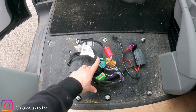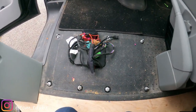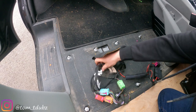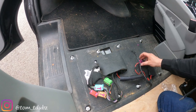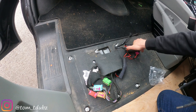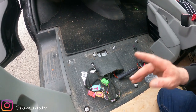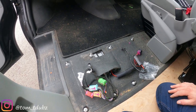Once those brackets are removed, what you're left with is a bit of spaghetti. What we're going to do is shove that underneath the mat — but what I'd suggest you actually do is feel underneath and thread this down to around about that position, and thread this one down to around about that position too. You don't want to forget where you've put stuff, so ideally remember that you've put your cigarette fuse down there. If the cigarette fuse goes at any point and the lighter stops working, you'll know where it is.